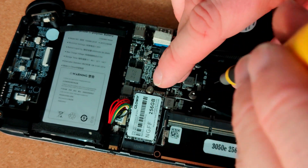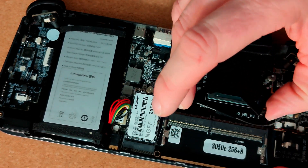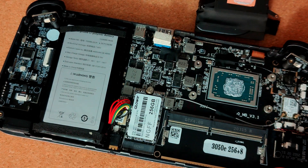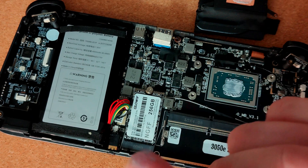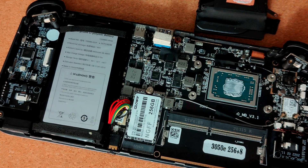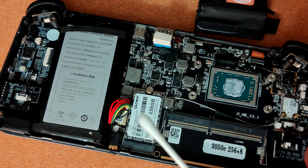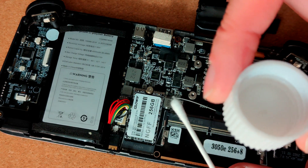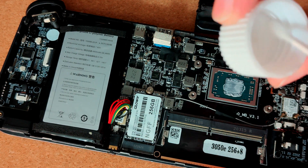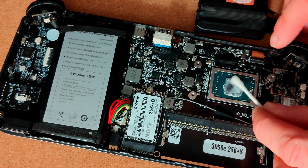I've edited this video a little, but the whole job is about 17 minutes and it really won't take you much more than that if you just take your time. As you can see, the previous owner didn't remove the original thermal paste - it's absolutely rock hard and dry. Get your isopropyl alcohol - I use 99.9% stuff, just put it in the cap lid and use a little cotton bud. Because of the high alcohol content, it just melts it away - piece of cake.